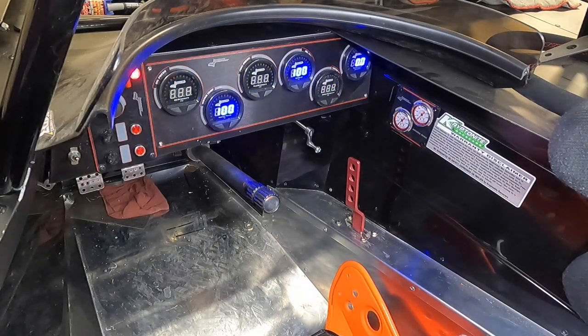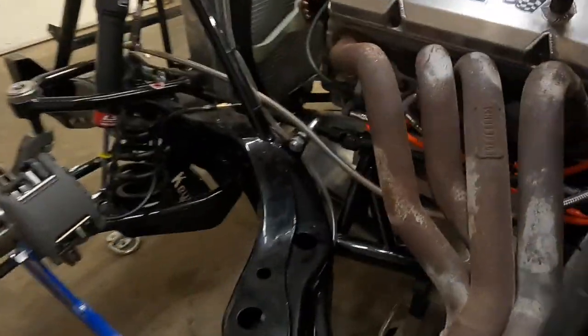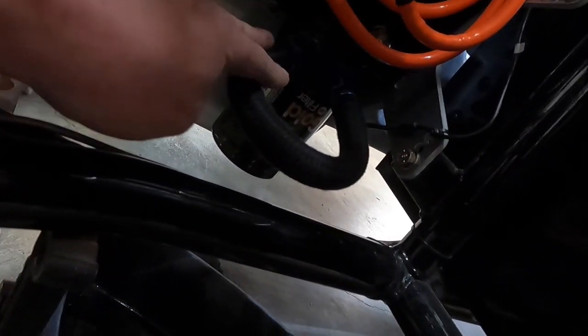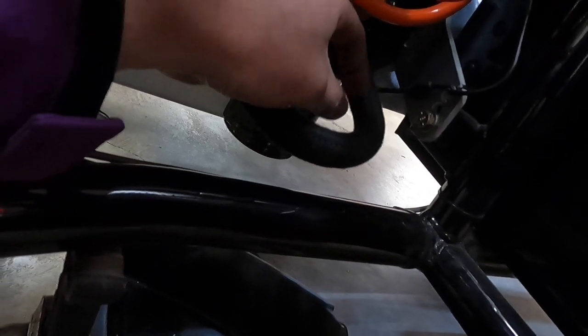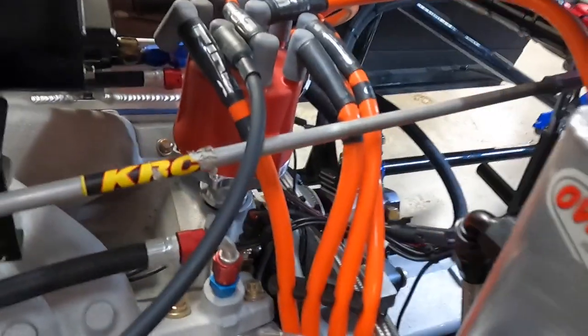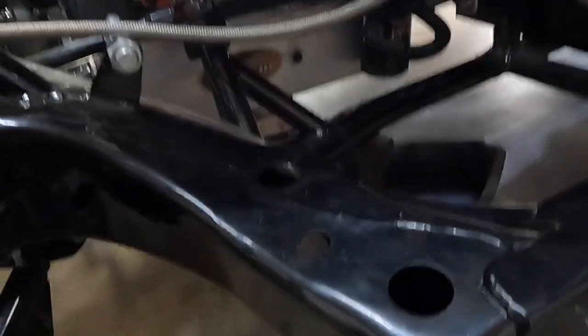So we got oil pressure. Any leaks on anything? Now we got a little oil pressure. Looking over here, we've got just this little closed loop deal for our oil cooler. We're not going to have that on yet, so we just made a little line to loop it around. Nothing coming out of the oil temp gauge, nothing coming out up here, the oil pressure gauge. Looking good.